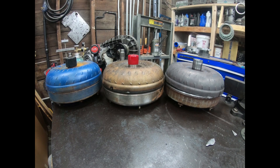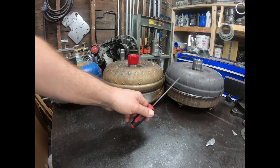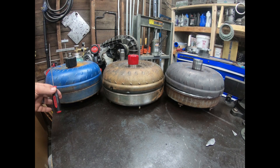Here's how you can tell the difference between the three most common torque converters found in a 4R100. On the far left, this is from a 5.4 V8; on the far right, this is the V10/7.3 torque converter — they're the same exact torque converter. When you talk about stall speeds, a lot more goes into it than just the torque converter: tire size, weight of the truck, gearing, the power band — all that combines with the torque converter to define the stall speed. That's why sellers use words like high stall, low stall, or factory stall, because they can't tell you exactly what the stall speed will be without knowing all that information about your truck. Ford knows it, which is why they can advertise different stall speeds.